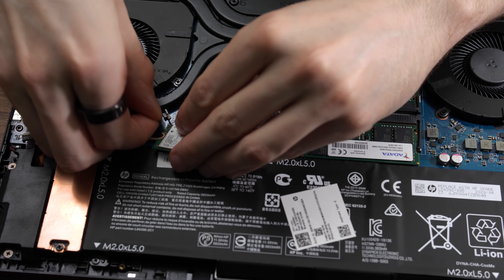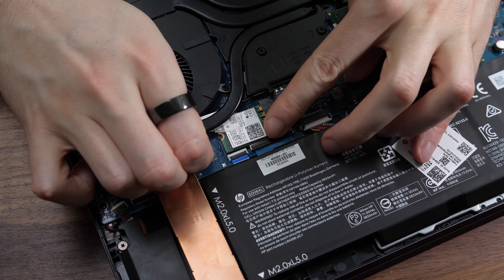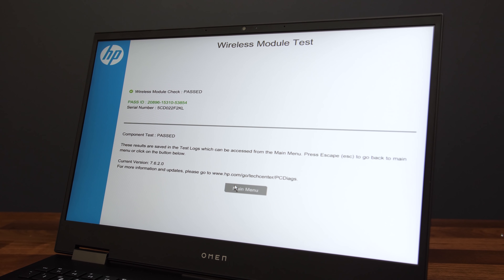Basically, unscrew the WiFi card and remove the two antenna cables attached to it. The two antenna cables are labeled 1 and 2, and the WiFi card also specifies this on its ports, so connect the new card the same way, put it back in, and screw it in place. Now all of this was basically for nothing, as I couldn't get WiFi working. I was able to use the exact same 6E WiFi card in the Lenovo Legion 5 without any problems, but WiFi 6E just did not work in the Omen 15. Bluetooth worked fine, just not WiFi. I tried installing the latest drivers from Intel and a bunch of other troubleshooting — even HP's hardware diagnostics tool thought it was good to go. Apparently HP have used a whitelist in the BIOS to only allow specific WiFi card models, though it sounded like this was an older practice. After messing around for a couple of hours I ended up putting the original WiFi 6 chip back in, so at this time I cannot recommend upgrading to WiFi 6E in the HP Omen 15, at least until it's properly supported.